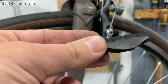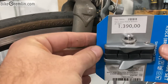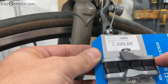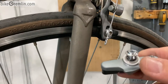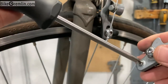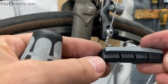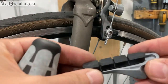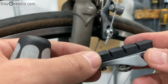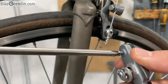What I recommend is another kind of brake. Here we have some Shimano ones, but any brake manufacturer makes these. It's a two-piece system where you have a metal casing that holds the brake shoes in place and you have replaceable brake shoes. There is a retaining pin here like a screw, so you can unscrew it and remove the brake pad, then replace it with a new one. This system allows easier adjustment and easier brake pad replacement, and generally allows brake pads to be of softer material that brakes better, especially in the wet. I prefer these kinds of systems — I think they are more reliable and better overall.